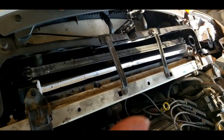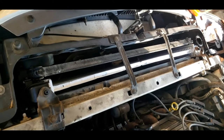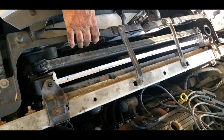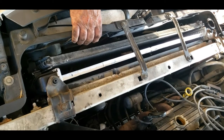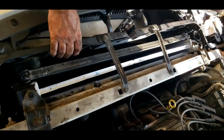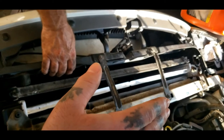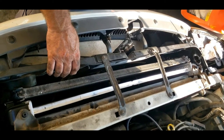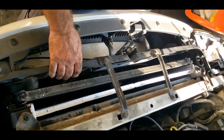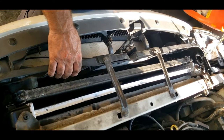Using pre-mix coolant in this. You can buy concentrate and mix it yourself to save money - usually mix it 50/50 with distilled water, so one gallon of concentrated is actually two gallons. Make sure you use the right antifreeze for the car. You don't want to mix types - I've seen some bad mishaps with mixed antifreeze and the wrong antifreeze running in the car.